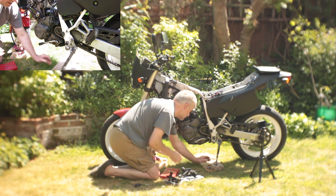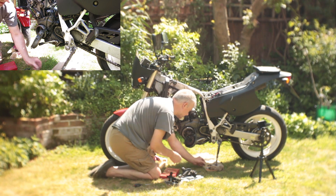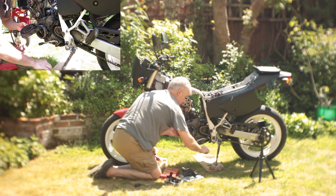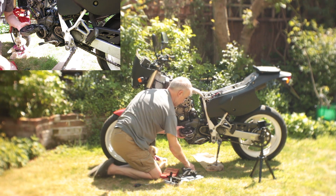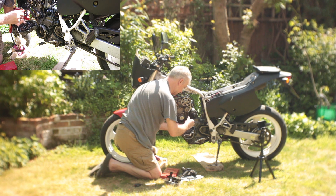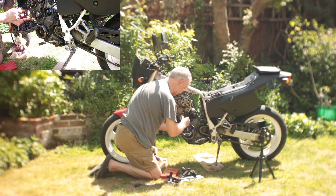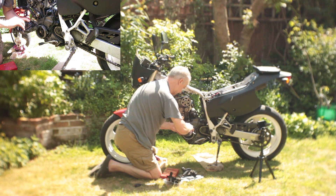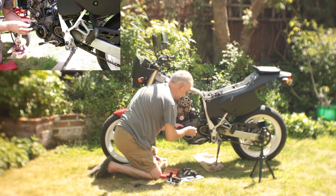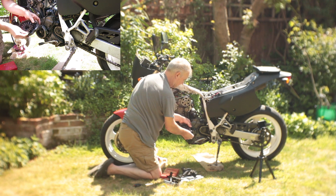Earlier I was trying to actually remove the coils but I didn't succeed, so I took all the bolts out — now I should put all the bolts back in. ACF 50 is perfectly safe on electrical stuff so it doesn't matter that I've got it all over the coils, though it might smoke a little bit if it gets warm. There's also this little cable retainer piece going on here.